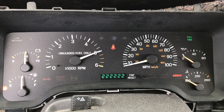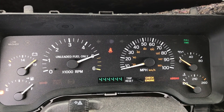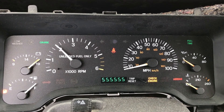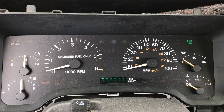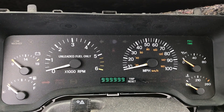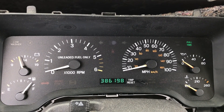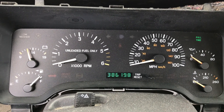You see how it's going through, moving the gauges. If you notice, only the gauges on the left are moving — none of them on the right are moving. On this cluster, the speedometer, the oil pressure, and the temperature gauge have stopped working. And that's a complete test.